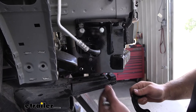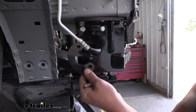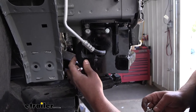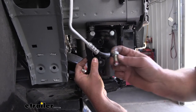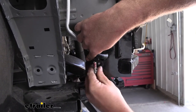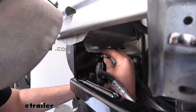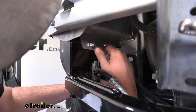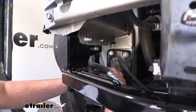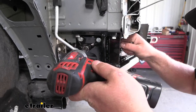On the passenger side where the hose runs through the base plate, take the bracket and put it in place — it lines up with those two holes. Take hex bolts and split lock washers, run those through. Where the bolts pass through, take nylon lock nuts and get both going hand tight. Once they're on, come back with a wrench and socket and snug everything down.